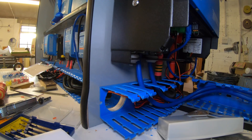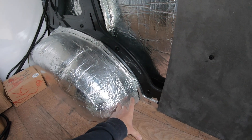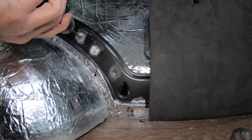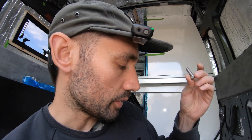I've run the cables from the MultiPlus over to these two. I've done everything for this now to go into the van. I'm now going to grind off a couple of points in the back for where we're going to earth to the van. I could use an angle grinder for this, however I don't really want to put a load of sparks in the van, so I'm going to use a little sander just to see if that works — here behind the electric cabinet. I'm going to make three earthing points. Earthing bolts going in — I'm just using some stainless steel M8 bolts. That's those three done, prepped, ready for tomorrow for the big install.